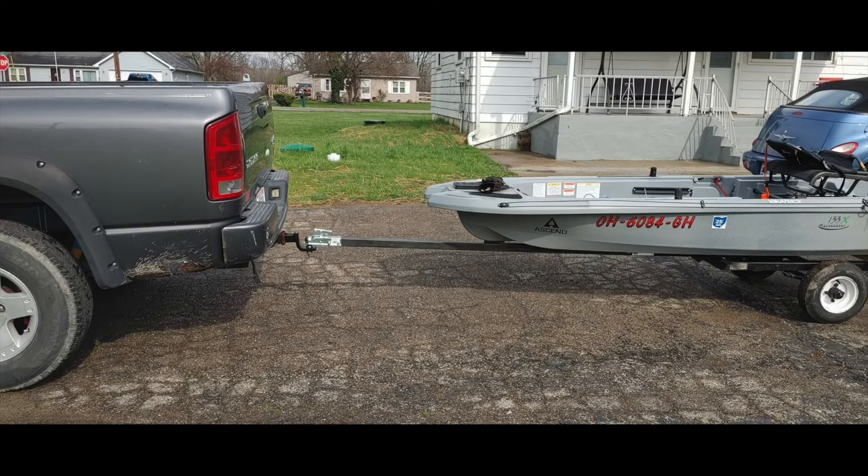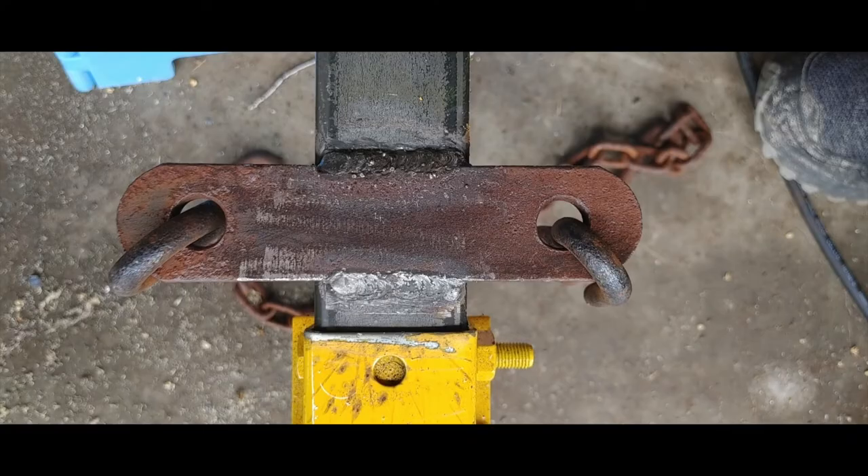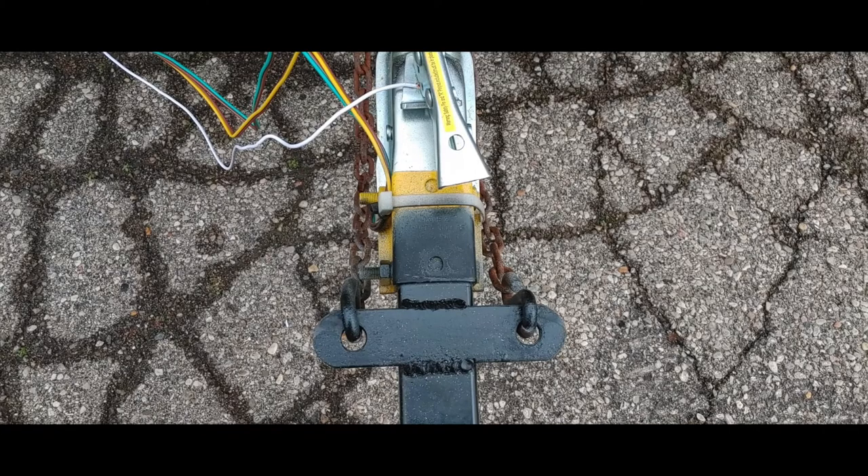Here's the trailer fitted up and attached to the truck. The trailer is not finished, but it's just to see how much clearance I would have between the front of the kayak and the back of the truck, and also with the tailgate down to make sure I've got room to get in there and work. That distance seems to work pretty well. I cut the safety chains off the old hitch and welded them onto the new hitch right behind the hitch to the tongue — that's not going anywhere. Here I've got it painted up in the black primer with the chains in place, ready to go.